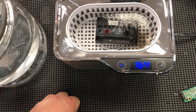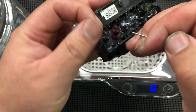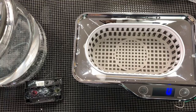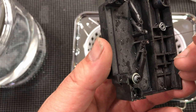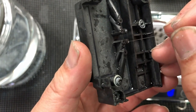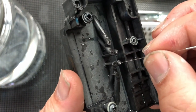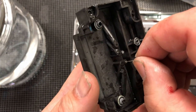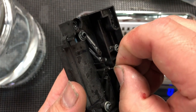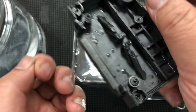First, let's use the ultrasonic cleaner to knock off what's around the clog so we can work on the issue. You can see the surface gets softened a little bit, so we just scrape it off. Notice this part is still solid. Then I use micro needles or drills to clean out this channel as much as possible. I'll put a link to the ultrasonic cleaner, the micro needle, and the drill in the description. The micro drill has a spiral, so it's easier to remove the rubbery clog. All we're trying to do is create some cavities so water or ink can get in there, and then the ultrasonic cleaner can work on it.